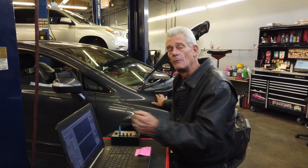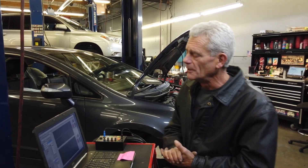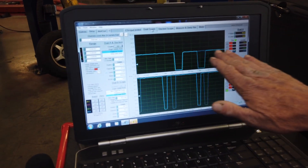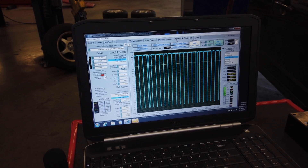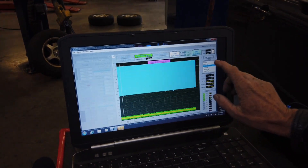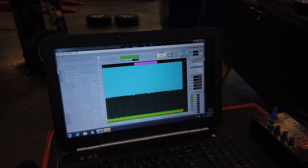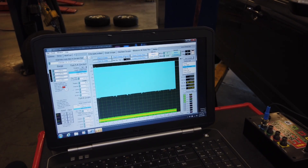As you saw from the video when we started, we had pretty good signal dropout on this waveform. Now taking a look at the scope after the crankshaft sensor is replaced, it's much more stable — we don't have those voltage dropouts. If we take a recording of it, right away we can see how much cleaner the signal is. We don't have the hash down on the ground line and we don't have the hash exceeding five volts at the top — a nice clean new crankshaft sensor in this car.